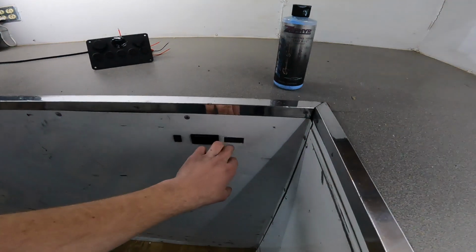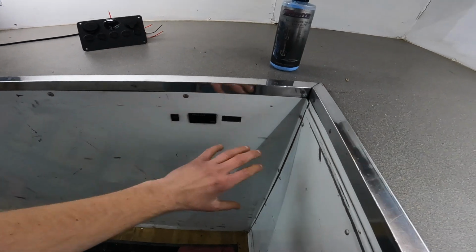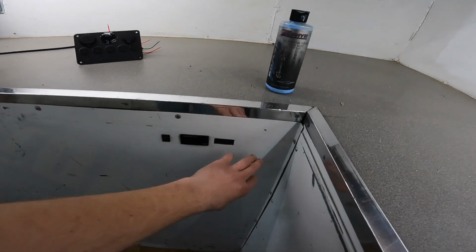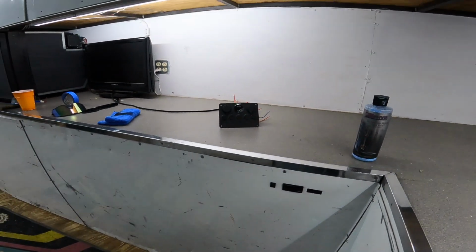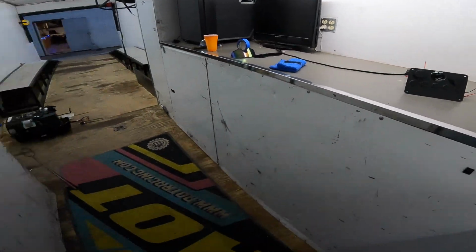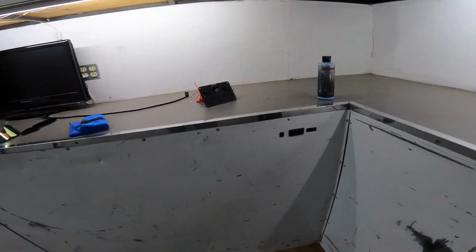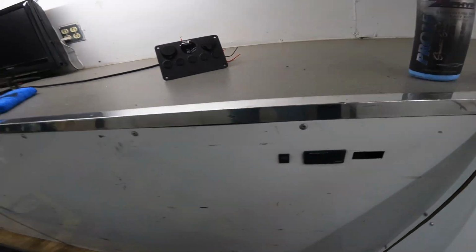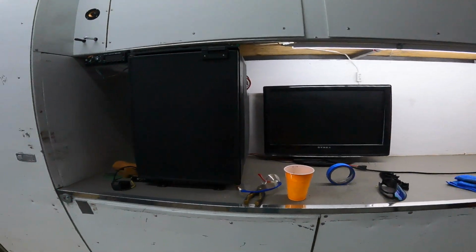Like I said, oil pressure, water temp, and maybe an ampere or a volt gauge, just so we can see that we're actually charging and stuff like that. So that's what's going right here. I'm going to get some glow shift gauges for all that. It's extra again. Point out that this diesel engine is going to have a generator or an alternator on it, which is going to charge the trailer batteries for the winch and the 12-volt lights and the rear pit lights and the fridge, which is why I said actually charging in that clip. 12-volt refrigerator, that's why I was saying it's going to be on a switch, because it's a 12-volt fridge.